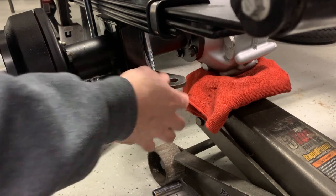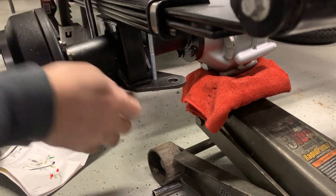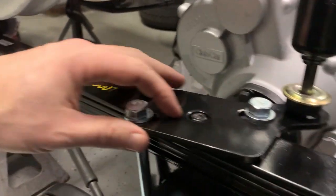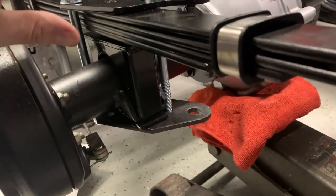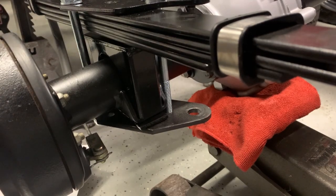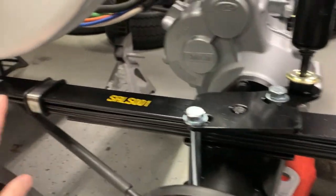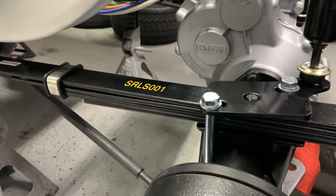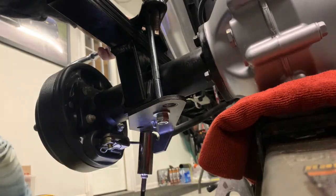All right, so everything is pretty much located. We tighten all this down, the locating bolt here on the top — that'll keep it there. When we put it down and everything gets tightened in it'll cinch itself up and it'll be in the correct position. Always remember when doing these: when you put in these HD springs, the longer side goes toward the front, measuring off of that center bolt.